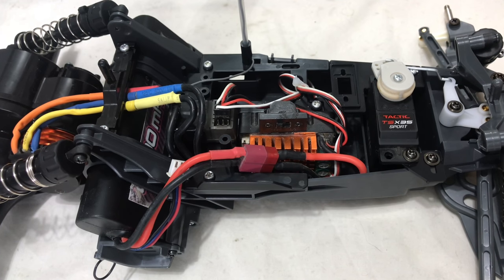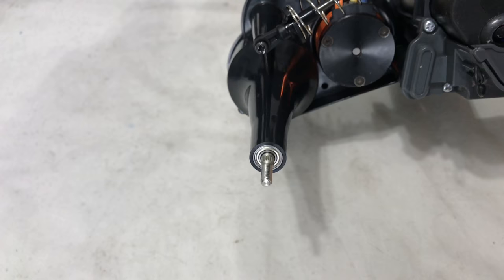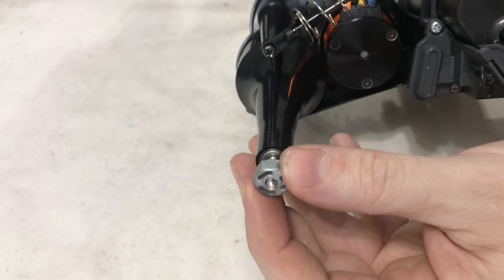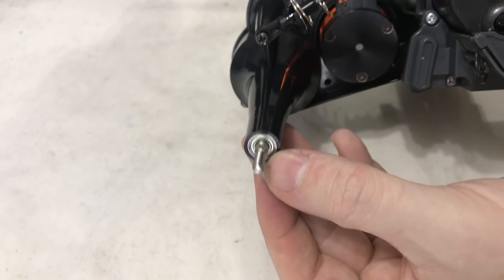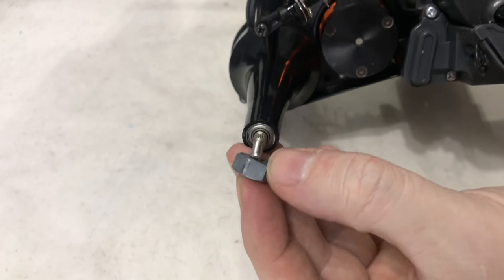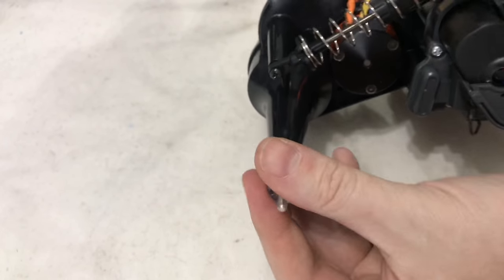I just went down to check the lacquer and it's just a little bit tacky still, so it's obviously going to take longer to dry. The next stage is to get those wheels back on when they're dry and get the tyres on and get them glued. I've been told these run on alloy hexes which just go on those splines like that, and I've been told you need to threadlock those on because apparently they don't last very long, especially with brushless. I don't want to get threadlock on the bearings, so my idea is to get threadlock in the hex itself, get that on the car, get the wheel on, and then keep my eye on it.